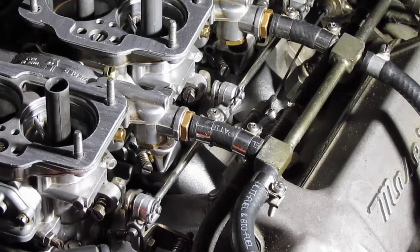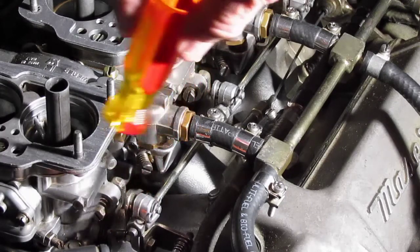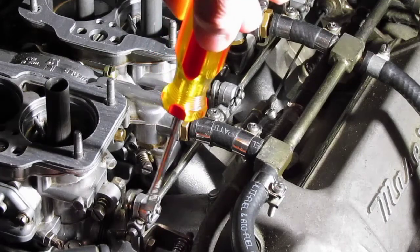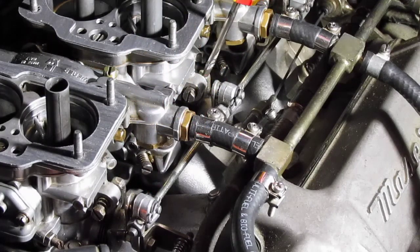It's very important to emphasize that when you close these two up on the rear carburetor and the front, make sure that you're constantly checking that this has not changed, because it's very easy to tighten things up on this end. And if you don't check that center carburetor, it might be really, really off. Don't ask me how I know — I just do.